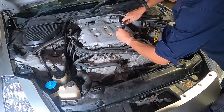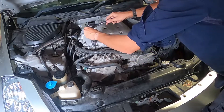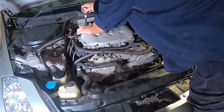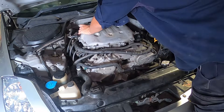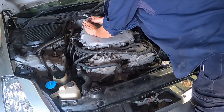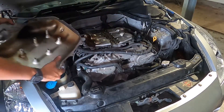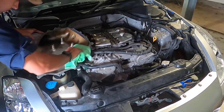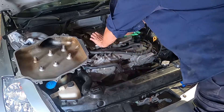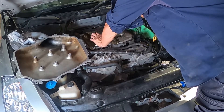Now we're going to start working our way around the plenum. I didn't go in the specific order that most people say you're meant to — I don't think it's that important — but I did torque it up in the order that's recommended. So we're just making our way around, pulling the bolts around the outside first, then the inside, and disconnecting the little bracket at the top left corner of the plenum. I then went around with a rag and wiped down anything in there that was wet. A lot of it was dried, which is what that black and brown residue is — which probably means I should look into getting a catch can eventually.